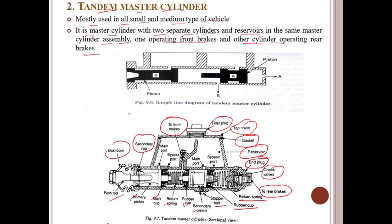A simplified diagram of the tandem master cylinder: under ordinary conditions, the brake fluid transmits pressure both to the front and rear brakes. When the brake pedal is applied and the brake lines are damaged, piston 2 will move until it comes against a stop. After this, pressure will start building up in the space between piston 1 and piston 2, and the rear brakes will be applied.